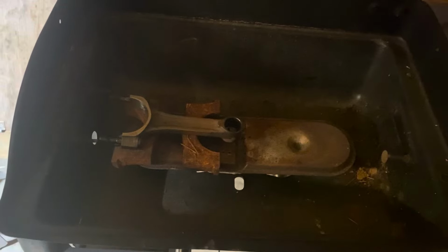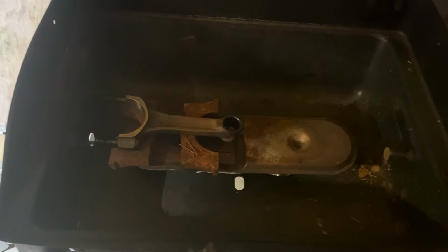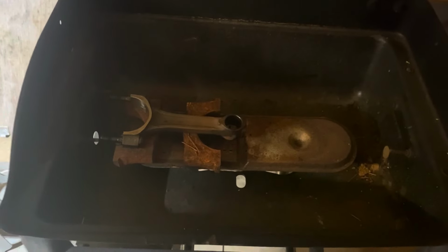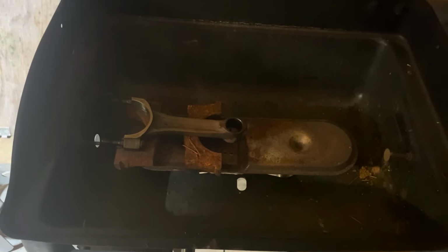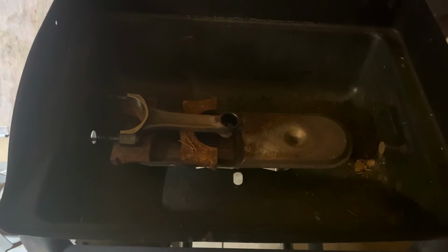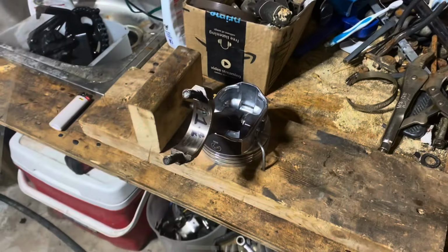And like I say, you grab it with the tool, and I get over to the piston in about 3 seconds, and then I have about 1 second. Once you push the pin through, you've got maybe a second or a second and a half to get it in before it'll lock up on you. So it's kind of a nerve-wracking process, and I can't show it on the camera, but I'm about to heat it up, get it hot, and install it.